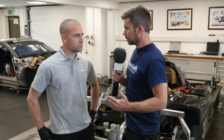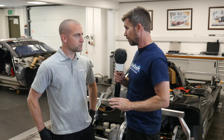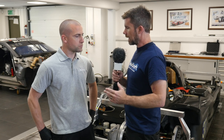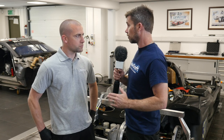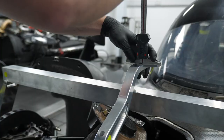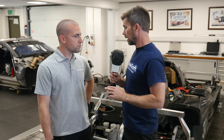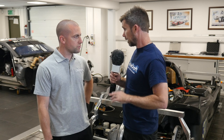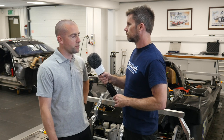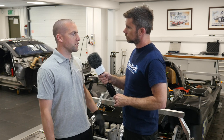As you've just mentioned, you're doing your setup here in the workshop, then you're flying away to another event where potentially you won't have a perfectly flat surface. So how does getting your setup done here allow you to confirm everything at the track? Basically, what we do with our scales is that every scale is levelled, and then we use a Starrett to ensure that at the circuit we try to replicate this surface table as best as possible. Once you've got the car set up at the track you can compare your setup values from here to what you're seeing at the track — and with a small tolerance we use that as our new baseline. If there's a kilo or two out when we get to the circuit, we see that as acceptable, and then that is our baseline to repeat throughout the event.